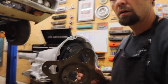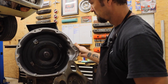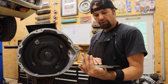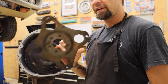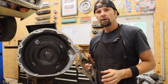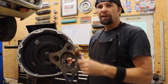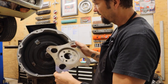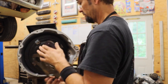This is a 2500 stall converter, by the way, so it should be perfect for this 440 street motor setup we got going on. On these flex plates, there's always one hole that's off. The best thing I've found to do is, instead of getting the transmission up there with the torque converter and then having to spin it to find which bolt's off — I put it up there first and try to match up the holes.